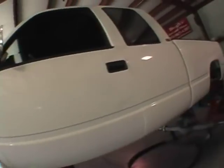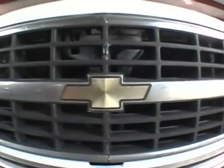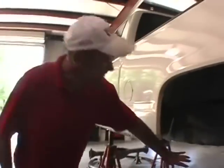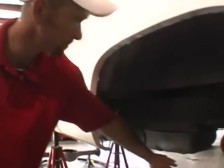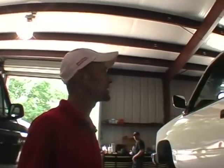Right now it's equipped with a small block 350. He plans on putting a 502 crate motor in it. The transmission will be a Turbo 400. We'll put a Profab aluminum transfer case in it. It will also have hydraulic steering. We're going to take the fuel tank out, put a fuel cell on the bed, strip it down as light as we can. We'll gut the interior, take the dash, everything out, just bare necessities. Probably going to put a roll cage in it with some racing seats and racing harnesses.